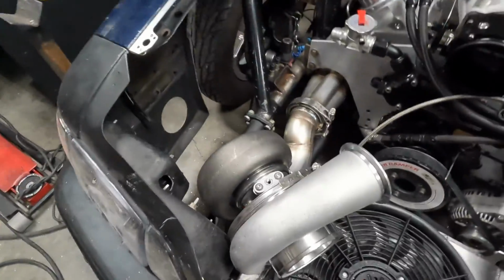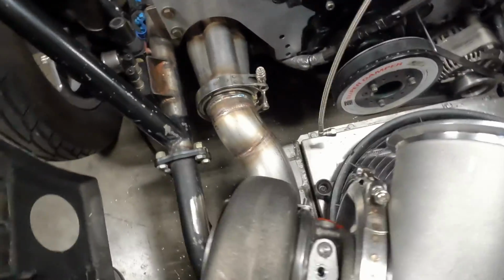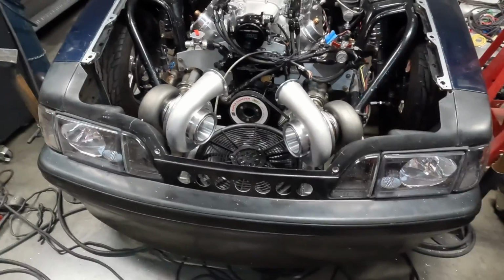All right, I'm knocking out a little bit at a time here and there, and we got the up pipes, I guess, from the header to the turbine side, the inlet of the turbine. They're both done. Of course, they still need wastegates fabbed in, and they also need back pressure sensor bung holes. So anyways, this is what it looks like right now. So got the up pipe on that side, got the up pipe right there. There's the front view. Started to look pretty good. I'm kind of excited about it, actually. So on to the next step.